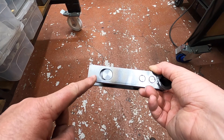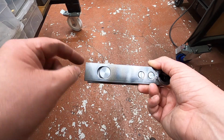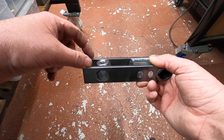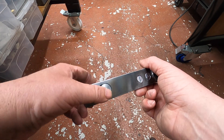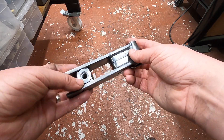I'm going to leave this end for now, just in case we need to make any modifications. I don't want to round this off and then find we needed to put a bar in there to stop it spreading when we put the brakes on. So we'll leave that for now, get it a working set of brakes, and then do the fine details after.